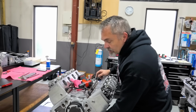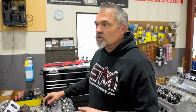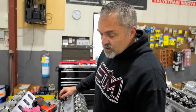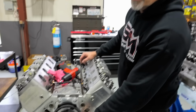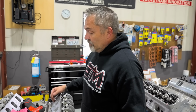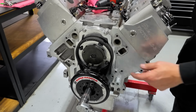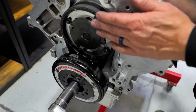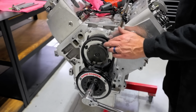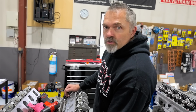Yeah. The belts are astronomically tough. The belts don't stretch. I have no idea how that's even possible. They don't ever seem to stretch. The belts are very tough, very resilient, last a very long time. The only thing that would screw up a belt typically is if you get something stuck in between there, or if you blow the engine up and it stops the camshaft from turning, then it shears the teeth off of it. But you can think of blower belts, all those other things, very, very durable. And the camshaft, they just are very durable. The reason why we would use them is infinite adjustability with a belt drive. Much easier to change camshaft timing, adjust, move, whatever we want to do for testing. And they absorb harmonics.